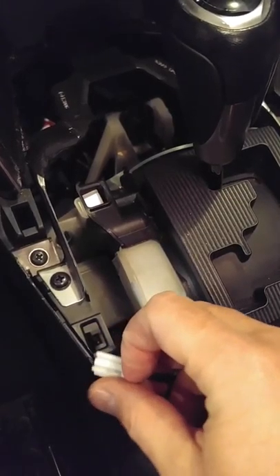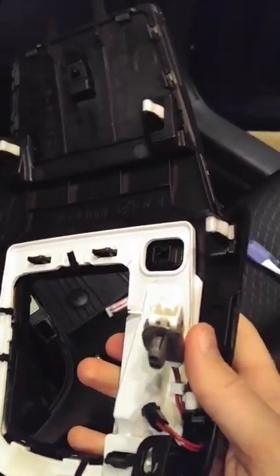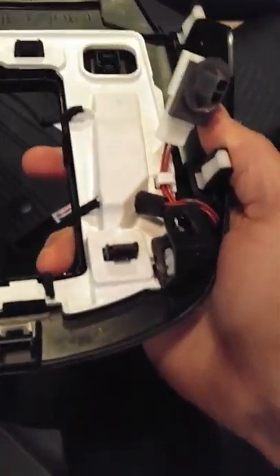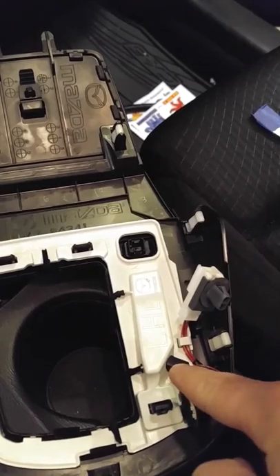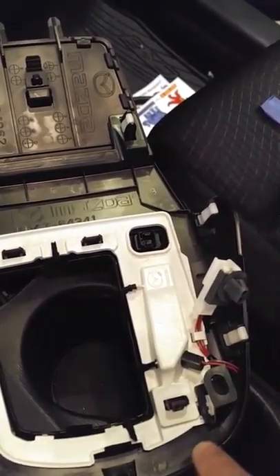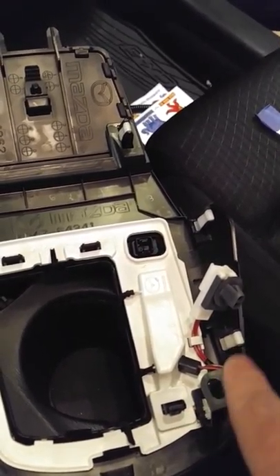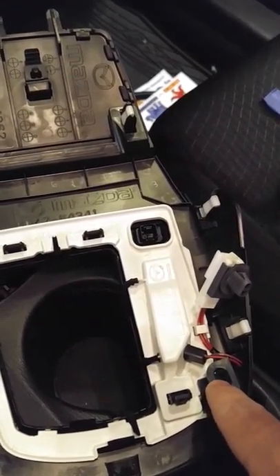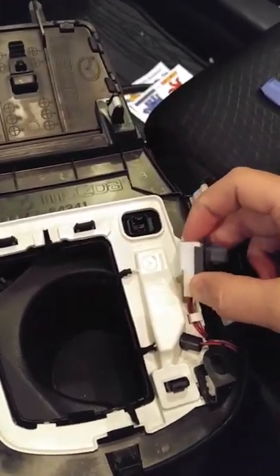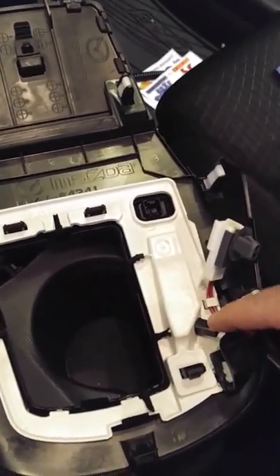When you do that, you've got a wiring harness for that console light right here — very easy to unclip. You'll have a little lever here; push this down and it'll slide right out. It's connected on the back side to this piece, which is usually mounted in there. You don't need to take this piece off. A good pair of needle-nose pliers will allow you to pinch the sides of that and pop it out of the way, then use those same needle-nose pliers to turn the bulb.